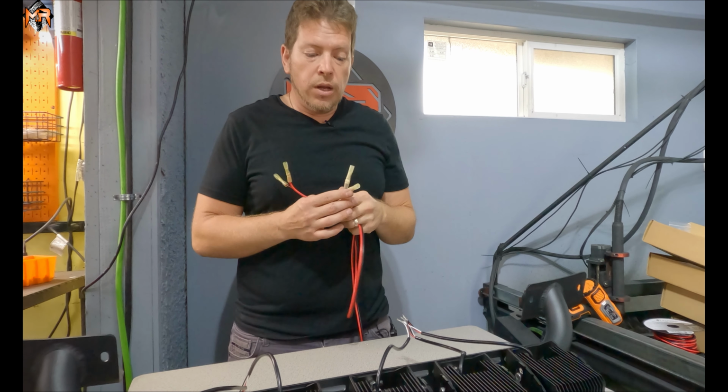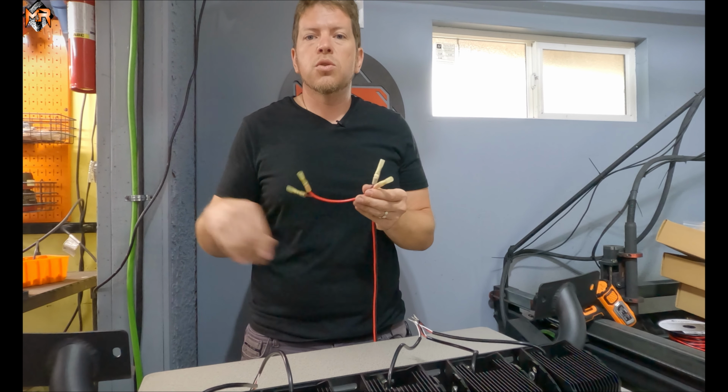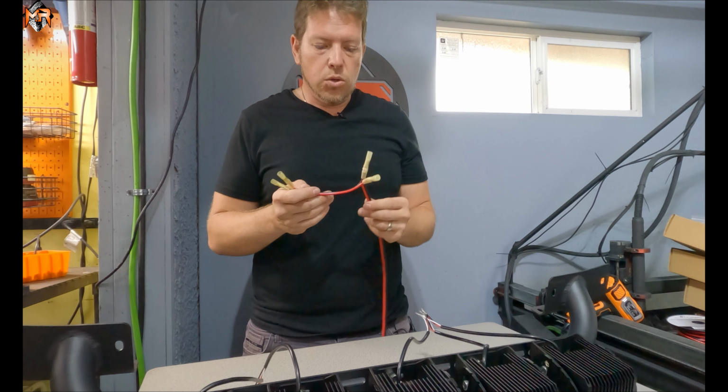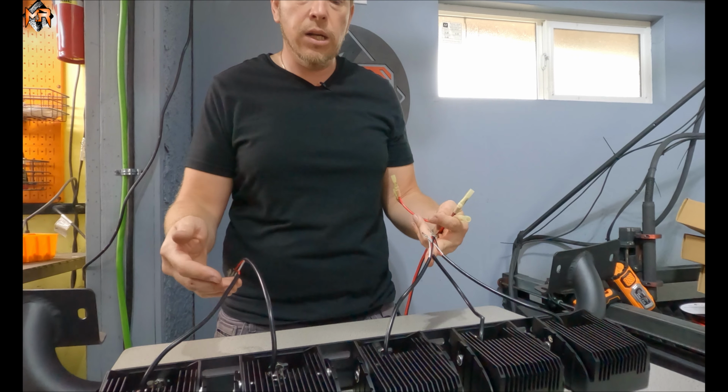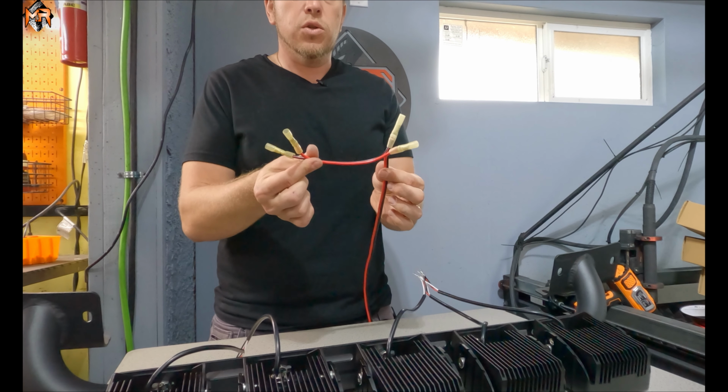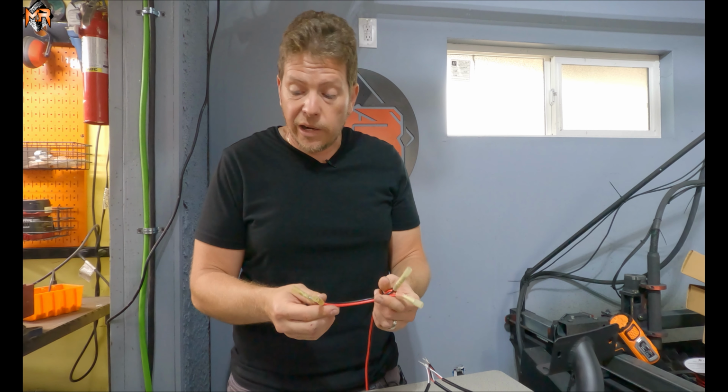What we're going to do, we're going to use a supplied harness in order to connect the lights to the harness to the auxiliary switches. So if you see there's a Y connection, the length of the lights themselves is not long enough to all fuse together. So I made a little Y intersection and kind of piggybacked off of it. Let me show you how I crimp it.